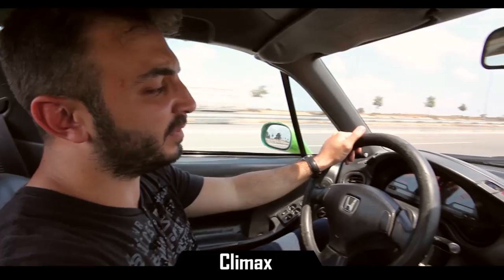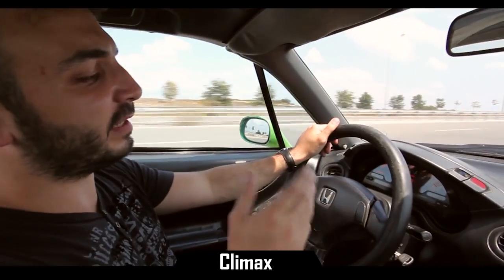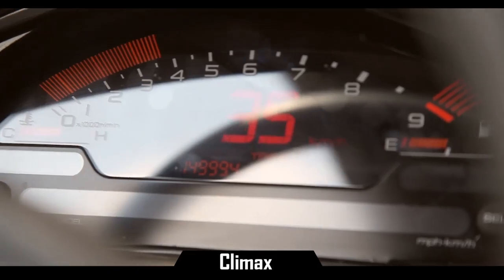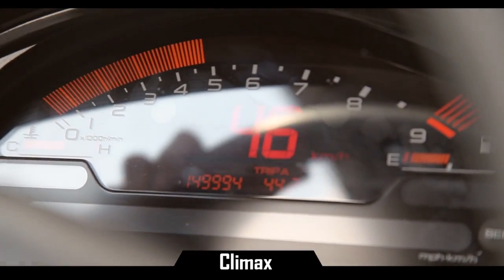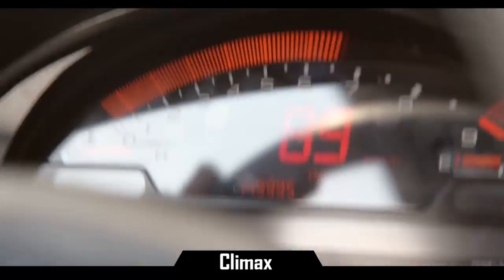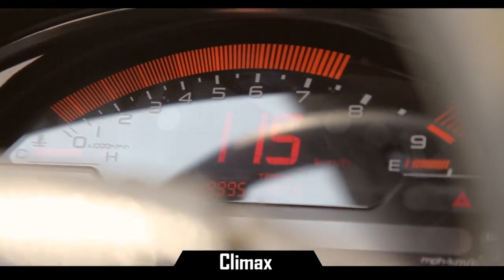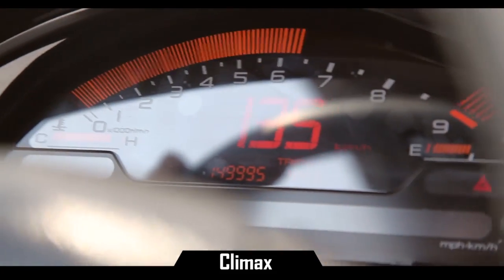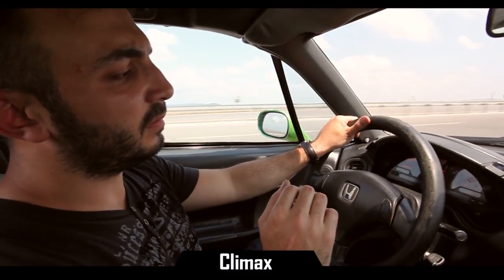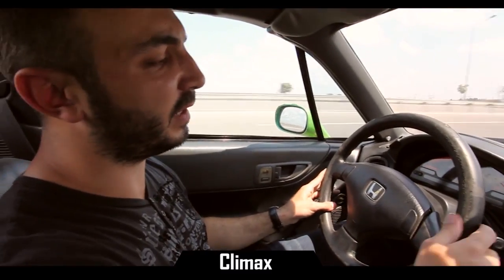This exhaust system is actually actuated by a specified RPM. On this car we've got it set to 5500, so it goes on with VTEC. I'll show you the crossover here — we're at four and a half. As you can see, that's an instant cutoff as soon as you drop below the 5500 RPM line.